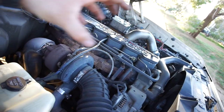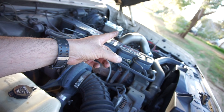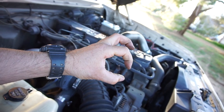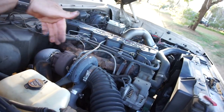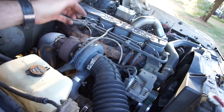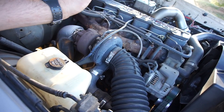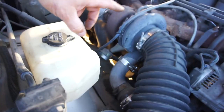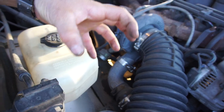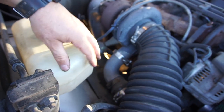These are two and a half inch tubes whereas the old ones were like one and three quarter to two inch. With smaller lines you get higher pressure - kind of like a venturi effect. But with the bigger tubes there's just a lot more volume of air traveling through, and the current turbo can't pressurize it well - it's just blowing it out instead of building boost.